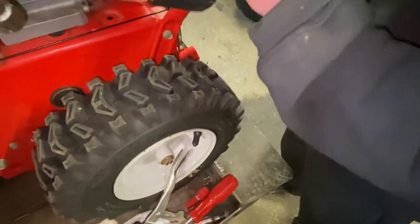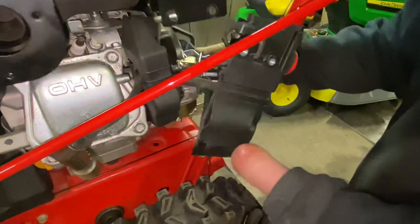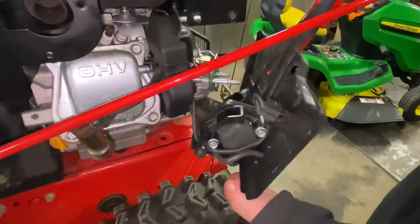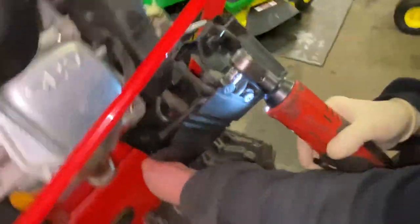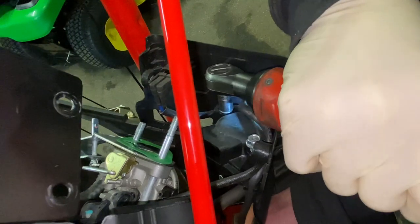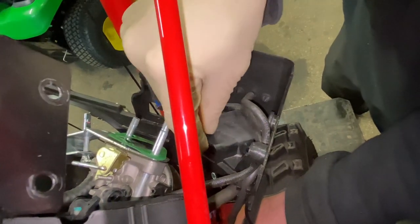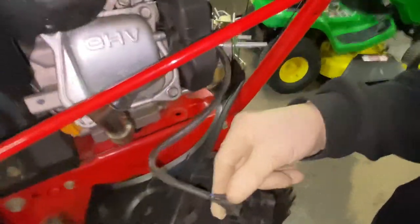Keep this video handy because you're probably going to have to look back on it many times. I'm going to pull this off and move it out to the side. Normally I can just move these out of the way, but this one may not quite make it — it looks like we're going to have to pull the switch out here. If you can't get that out of the way, you're going to have to take this off — it's not a real big deal, just trying to make it one less step. This is just the top of the carburetor, just a cap. There are no air filters on these carburetors because technically there's no dust when it snows. Remember these bolts are long, and once this cap comes apart remember how it goes because you have to get your fuel line behind it. This will come out of your way and you don't have to disconnect the electrical — just leave it alone.